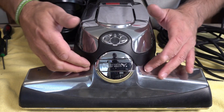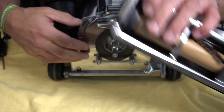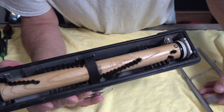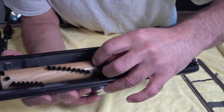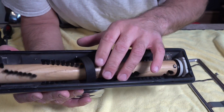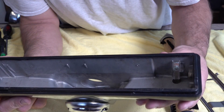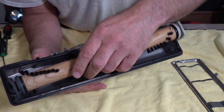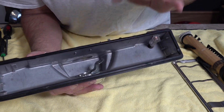We'll do this via timelapse and then stop and have a look at the condition as we go. We'll start by taking the portable head off - these brush rolls are normally pretty bad. As we turn it over, the brush roll looks pretty clean. We've got a few hairs and a few dog hairs. It looks like she's been burning belts at some point so the belt probably needs changing - it's probably the original belt from when she bought it. Other than that, there's no wear or gouges, that's pretty reasonable. Inside is pretty clean as well, no corrosion.